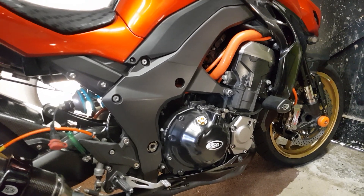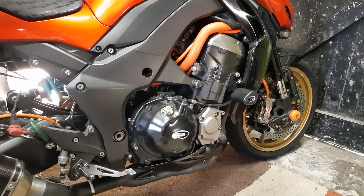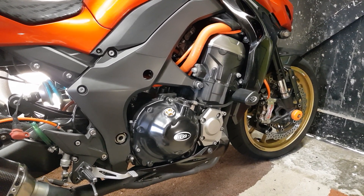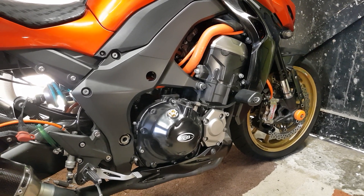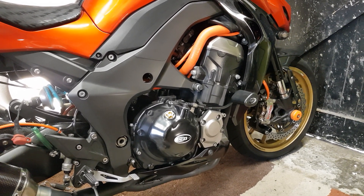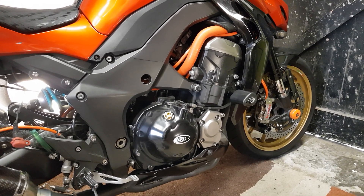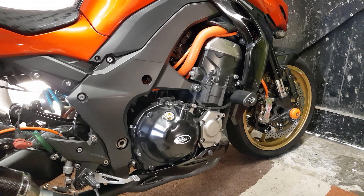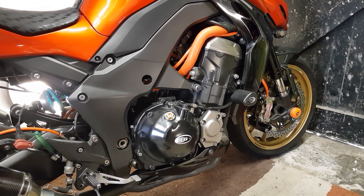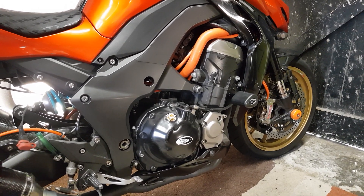The main thing is this has had an ECU flash, which lots of people have done. This was done by CJS Racing. If you're thinking of getting an ECU flash, make sure you go to a dyno guy that can actually do all the extra bits and pieces, because a fuel map is not everything on these bikes.